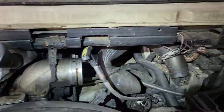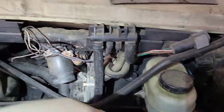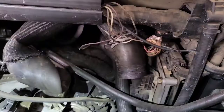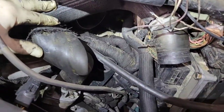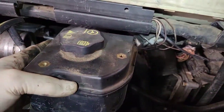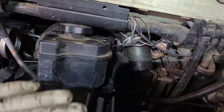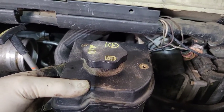To do this job, here's how it looks with everything disconnected. Here is the upper radiator hose just pulled out of the hole. Here is the dipstick disconnected from its plastic clip. The CAC tube is disconnected from the intercooler. The power steering reservoir is unbolted from the bracket — there's one bolt here, two bolts up here, and three bolts total. You got to take the cap off to get the reservoir out from the bracket.